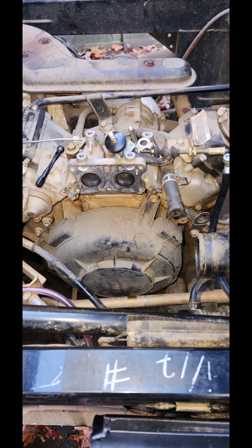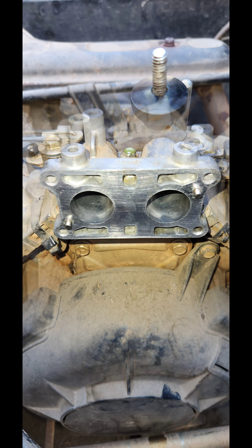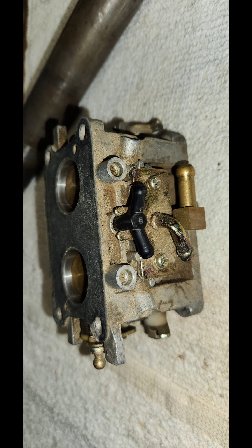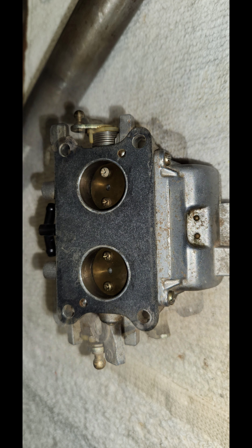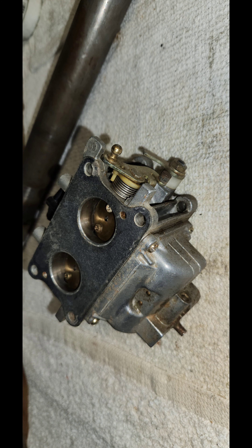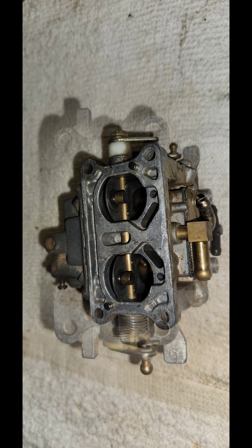Take a little time to clean the carburetor mounting surface and cover the holes with a rag or paper towels while you're doing the carburetor work. Assuming you have a carburetor rebuild kit, scrape all the old gaskets off and use a Scotch-Brite pad and toothbrush with brake cleaner to clean the outside of the carburetor. These are some before tear-down carburetor reference pictures.